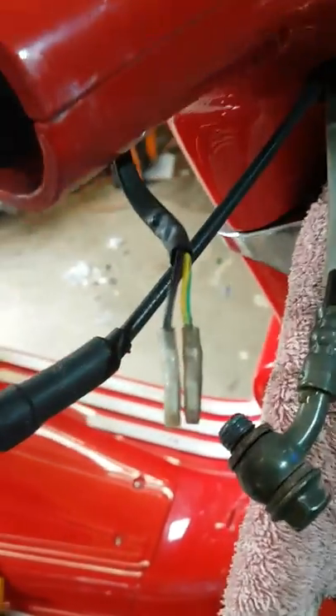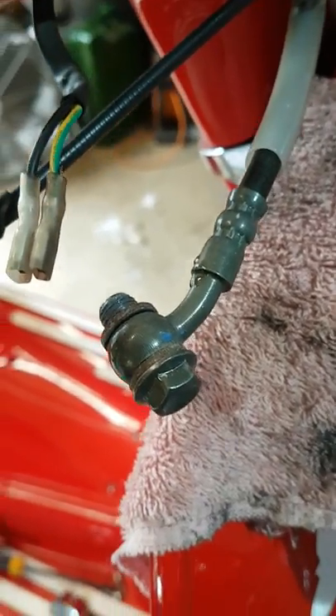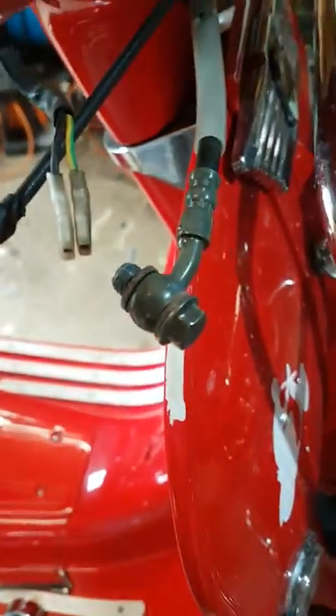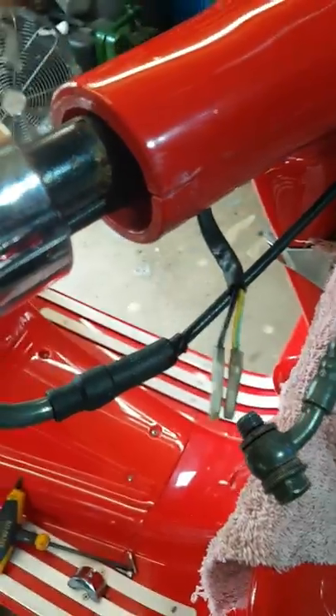I've removed the old reservoir, disconnected the brake switch wires, and disconnected the pipe. Normally I'd put some new washers on there, but I'm just going to go through this quickly. This has been leaking for a while, and because it's been leaking it's caused some damage. There's quite a bit of damage anyway so it's being changed — that's what happens when the customer leaves it so long. It's just been dripping down and eating away the paint. If you're doing this, make sure you cover everything up, and it's always good to rinse it off with water afterwards.